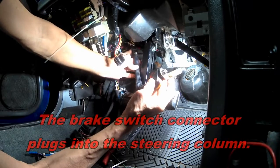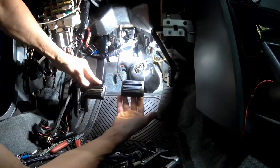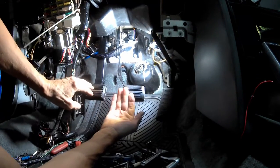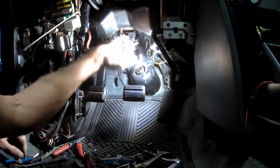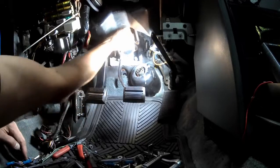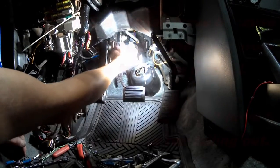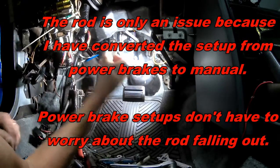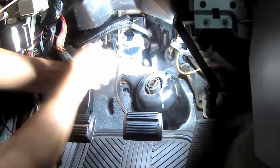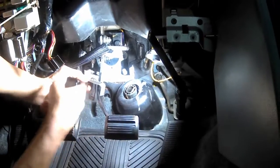The connector is way back up in here. To set the depth of your brake switch: push the pedal in, push the switch in, and you can see the pedal isn't coming back as far. As you bring the pedal back, it keeps pushing the switch back and that adjusts it. The steering column is going to go in here and hold it in place. Now that I've set that depth, to keep this rod from coming out of the master cylinder all the way, I've made another bracket that'll trap the brake pedal, so when the pedal goes down and comes back there'll be a positive stop — it can't lift any further than I want it. I slid it so I can adjust it.